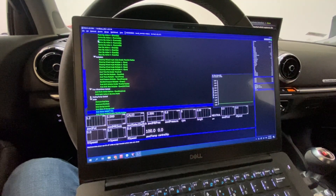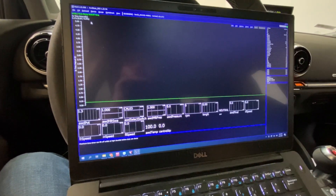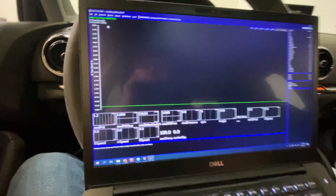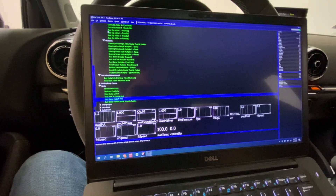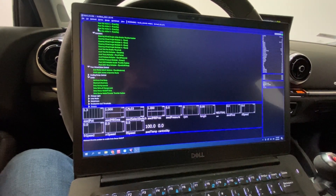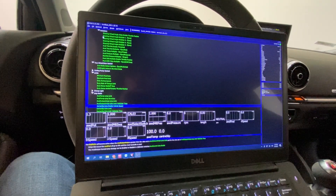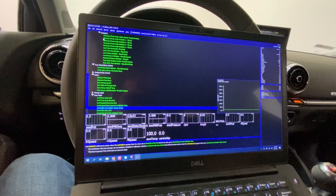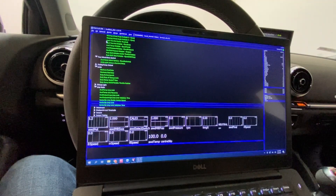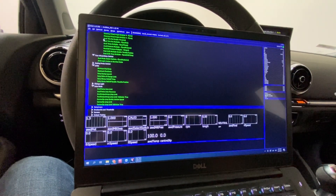The change light doesn't work on the RS3. Decay time is like: if you lift off the throttle, is it going to snap the Haldex to zero or come down gradually? I find under a quarter second is the most predictable. That just shows you the minimum throttle for decay to be working. Limp modes let you say: if there's too much slip or too much current, shut down the all-wheel drive - these are ways to limit the output to the rear differential.